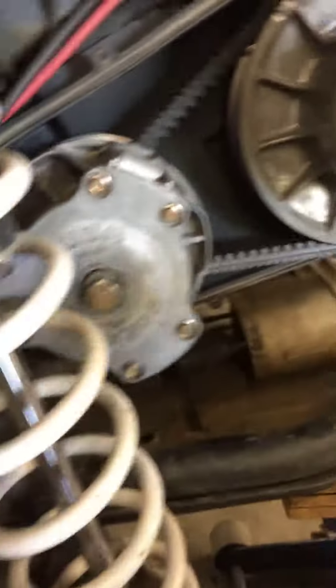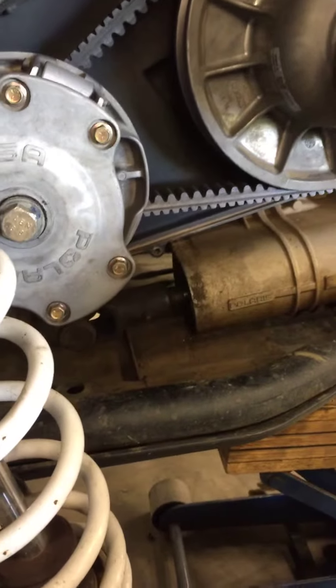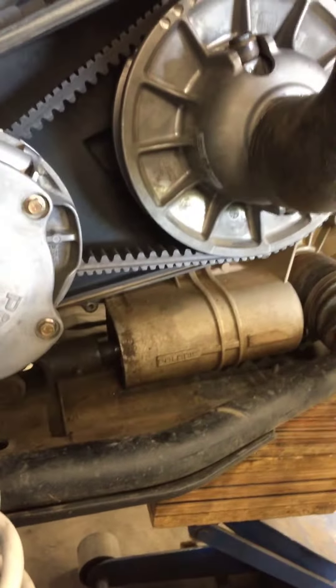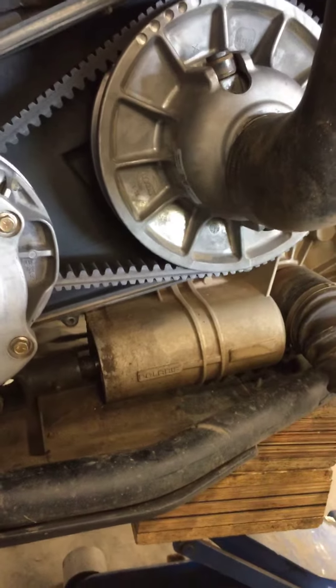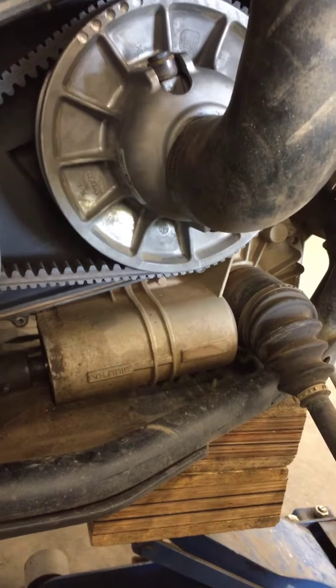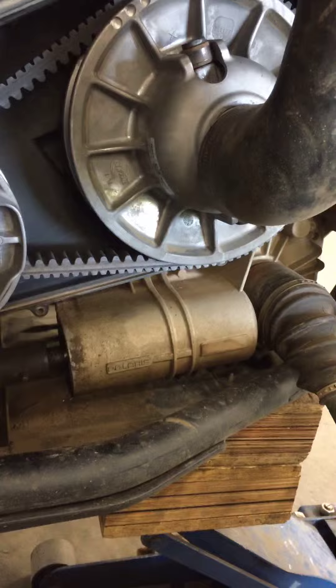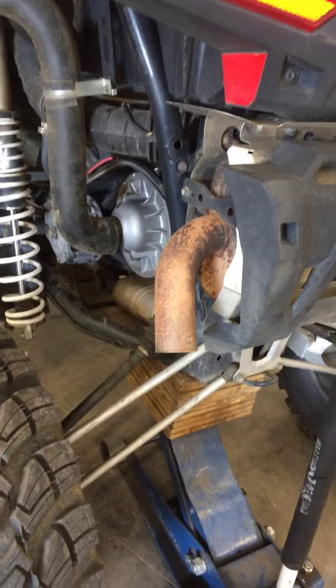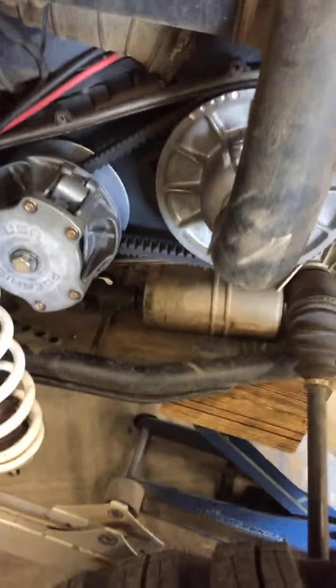The combination of loose bearings, loose axles, drivelines, and then the speed sensor not reading the same speed as the clutch is going to cause it to go into limp mode. It thinks it's losing a cylinder when that stuff doesn't all line up. So anyway, I don't see anything that we have done here whatsoever to cause any of the issues you may be having.